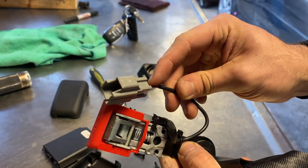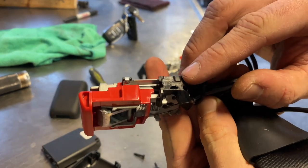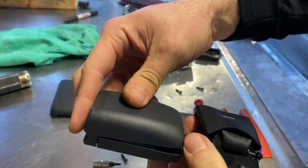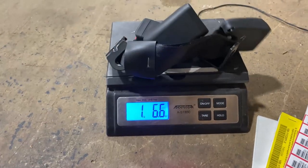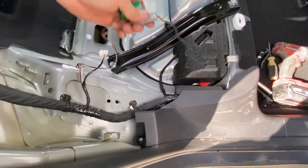What this thing does is it's just a little sensor that senses when somebody has a seat belt plugged in — this piece clicks down and it registers that there's somebody in there. All we need is this black little piece here. We could probably accomplish the same thing with some combination of resistors, but we already have this. Your best bet is to stick the buckle back together so you don't lose any of the parts — that way when and if it's time to put this car back to stock, you have everything needed. So this is what you're left with, and because we did that, this is what we get to get rid of. Is this incredibly excessive? Yes. But my theory is: if you pay attention to the little stuff all across the car, it adds up.